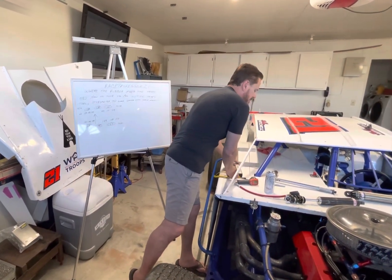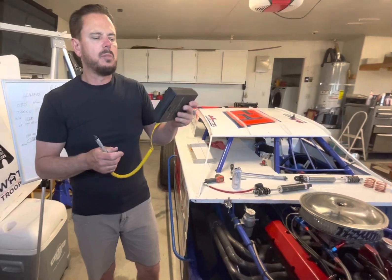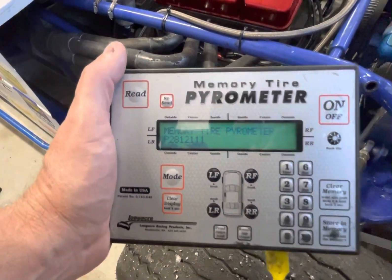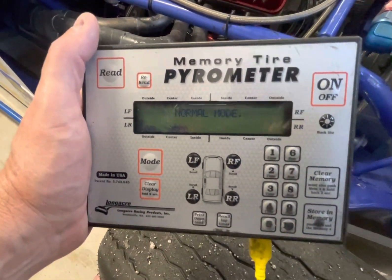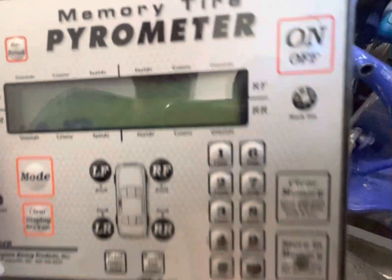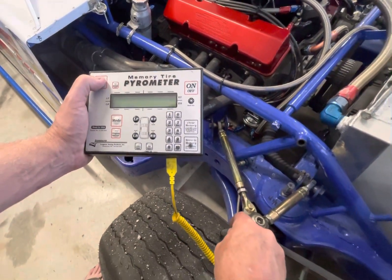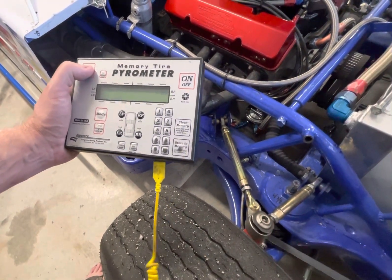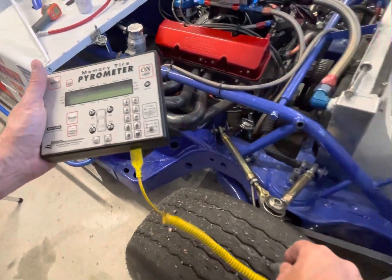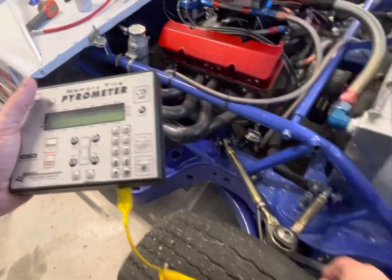Now, tire temps — this video is about tire temps. We talked about the tools. Now let's talk about how to take tire temps. We're going to start with my pyrometer. We'll set it down so you can see the tire and the gauge. We turn it on, and you'll see it automatically goes to the right front — it says 85 degrees. I'm going to stab the right front outside of the tire and hit read. Then we go to the middle — that's where the probe comes in, getting more of a core temperature — and read it again. Then we go to the inside of the tire.